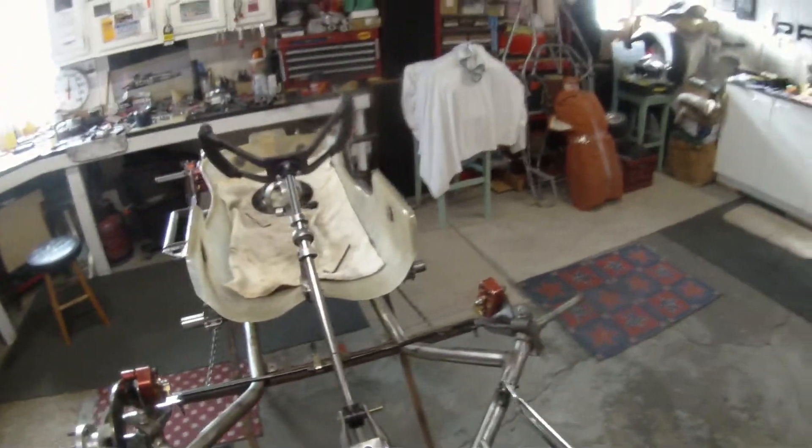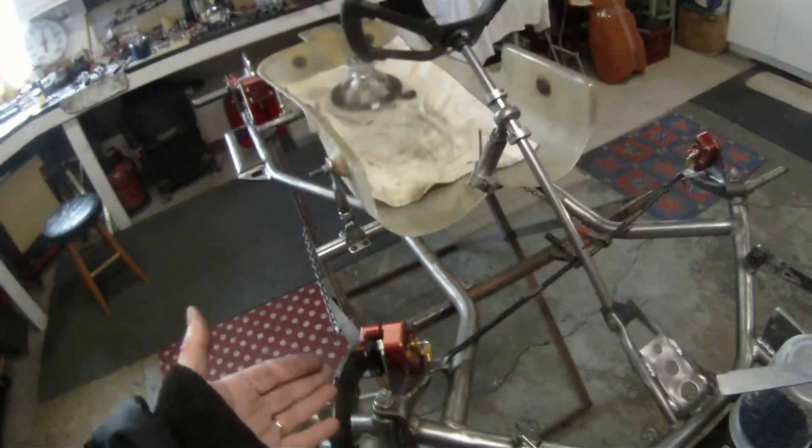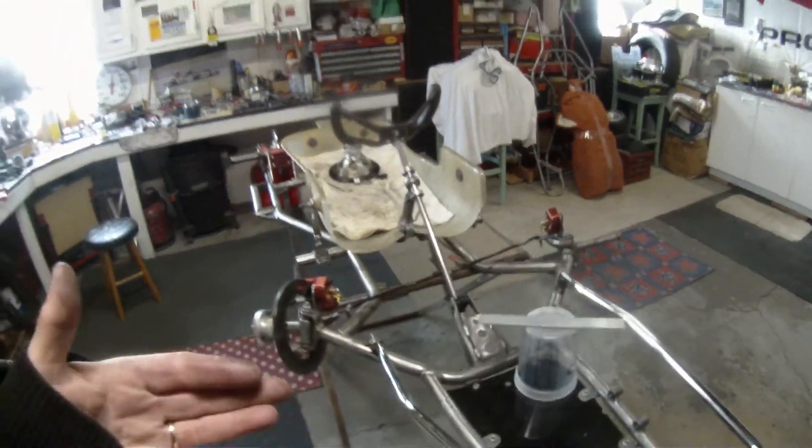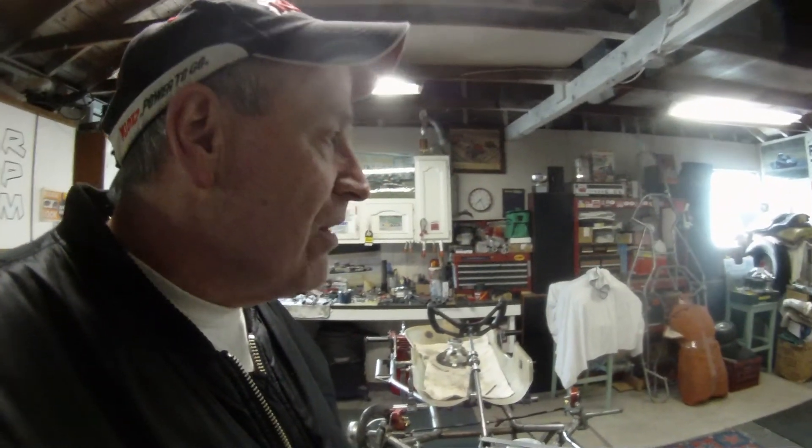So there's your lesson for now. Once we get it up and running, I'm really looking forward to people who have never driven a cart with a self-adjusting brake system getting their first impression — not how fast did it go or how did it handle, but how did those brakes work? It'll work with an NGenetic system. It'll work with a CIK system. The only issue with the CIK is you're going to have to put a real master cylinder on and get rid of that slave cylinder. Or you can use that slave cylinder with a fitting in the top and buy a Schrader valve or some type of pressurized check valve — they cost 80 bucks. That's why I just got rid of those things on the old GP chassis and used American master cylinders.